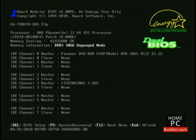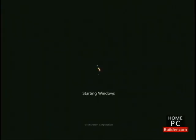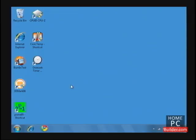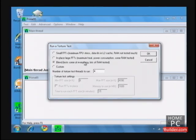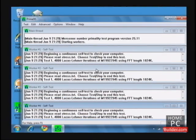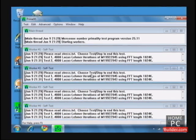The system restarted and is going into Windows. Once in Windows, we'll start Prime95 and use the Blend setting to stress test the system. With Prime95 running, you need to look for these icons to turn red, or an error message in one of these windows, or if the system freezes or blue screens and reboots — you've pushed the reference clock too far.